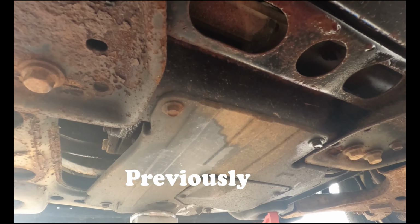All right, there's that. Here's the rack. I think it was leaking right here on the end. The low pressure line came with a new seal, and the pressure line came with O-rings. So I guess it's a new design. Hopefully it works. So I have the mounting holes lined up. I have the boots about the same. I have the ball joints the same. Done with the old rack.